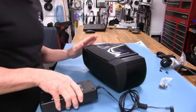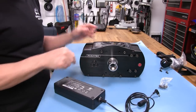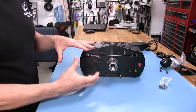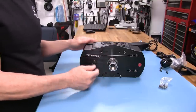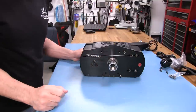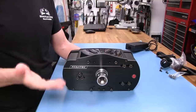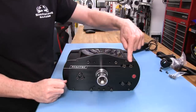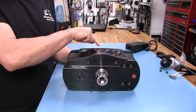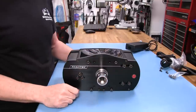The power supply output is 24 volts at 7.5 amps — that's pretty good power for this motor. They say up to 8 newton meters, but the motor itself probably doesn't put out 8 newton meters; it's the pulleys and gearing that create the maximum 8 newton meters. They also use what they're calling Direct Sensor Tech — basically two hall sensors: one on the back of the motor and one on the motor shaft. Having two position inputs is always a good thing.